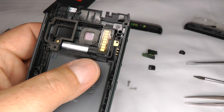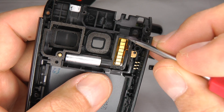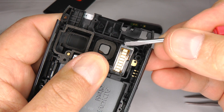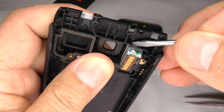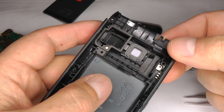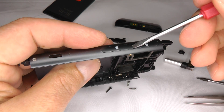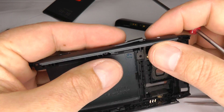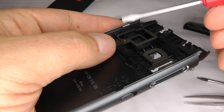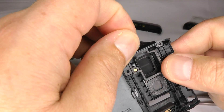Now we've got the camera flash. Use your blade screwdriver to get in there and lever it out — there's a small plastic clip that locates in that slot. Once you've lifted that up you can take it off. If you're replacing the covers, you can just take them out — they come out quite easily. Push them out from the back and just lift them out.